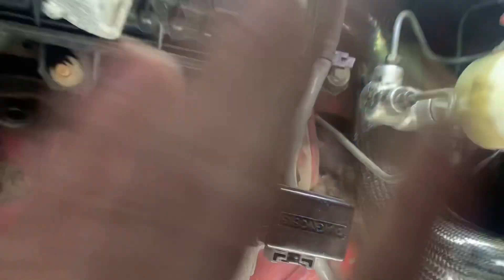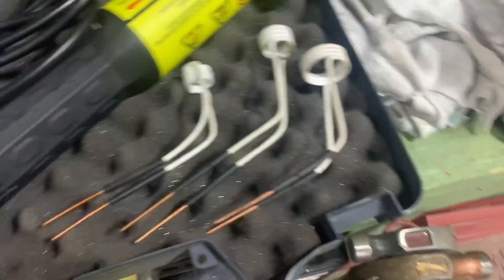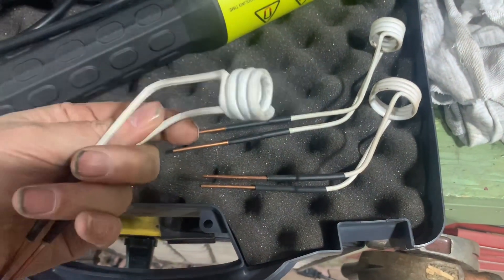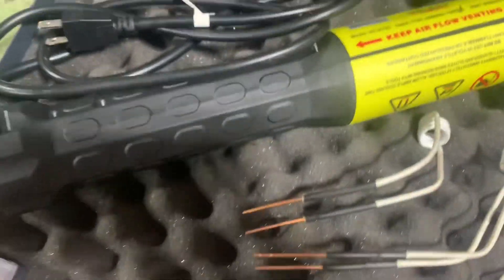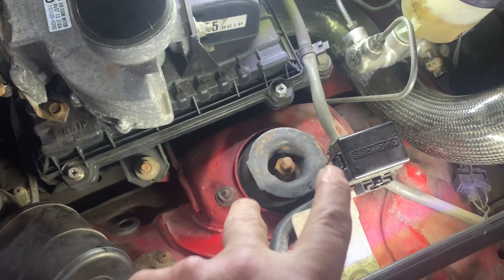So I'm going to try and take these out. Now, what I'm going to do — I made a video about this thing when I got it, and I don't think I ever did a demo of it or tried it out in a real-world situation. You can see I've used it a few times; there's some burns on the coils from not being too careful. It doesn't hurt them and you can replace these — they're not too terribly expensive. But I have been using it a fair amount, and it's worked every time. It's solved my problem. So what I'm going to do is use an induction heater to heat up these bolts. We're going to try this one first, along with the PB Blaster, and see if it comes loose, then give that one down there a try.